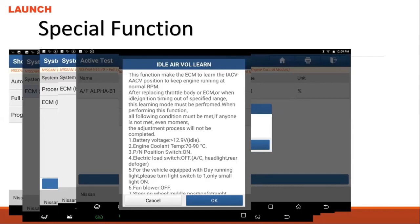Even using the Nissan original scan tool, there is the same notice. The OEM technicians will take care of it, but outside workshops they always ignore this notice. Then after that they complain that they cannot do the throttle body learning. That's why I need to mention this here.